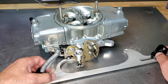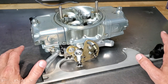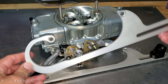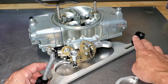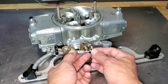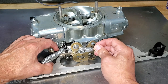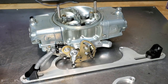What you might be looking at here is these attachments. When you convert from a stock carburetor to an off-the-shelf aftermarket carburetor, typically your connections won't work anymore and you have to get adapters. Jegs has different adapters - I went with this particular setup because I was able to bore out the rear section to fit my stock GM gas pedal connector. Then I came up with a little clevis design with a cotter pin, and I wanted it spring-loaded for a spring return. This bolts right to the carburetor studs and I like it a lot.